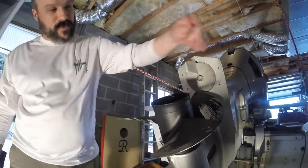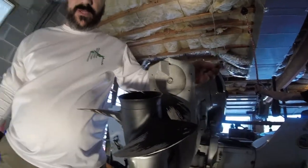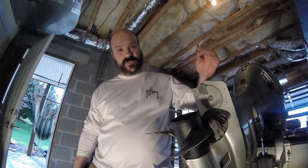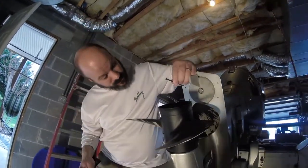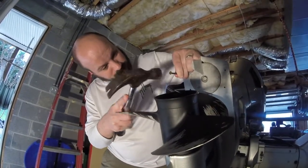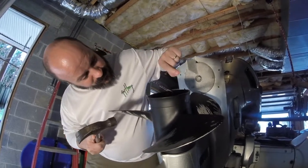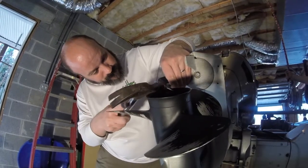I have a nail I'm going to actually set. With my bits, when I'm using a bigger drill bit, I like to set the mark first so that the drill bit will hold in there and it's not moving around on the actual plate. So we'll start with this one here. I'm just going to tap it a couple times. One. Quite difficult to see, but there is just a little mark there. Get in the center there.